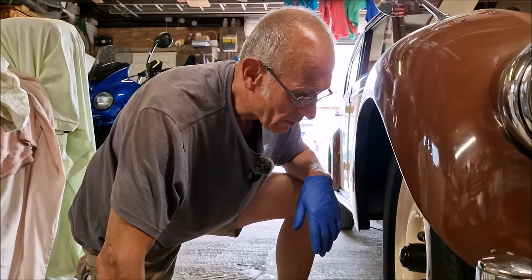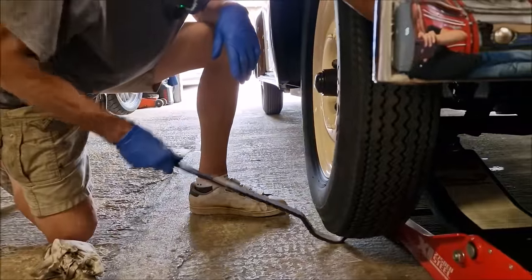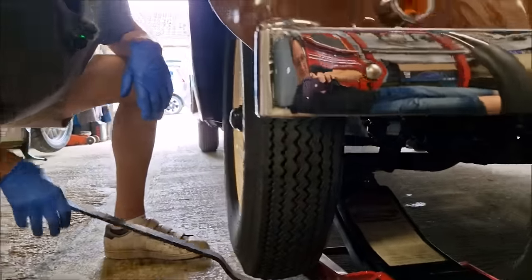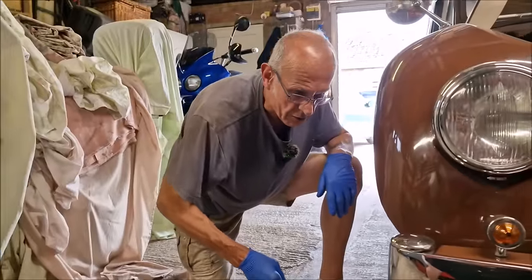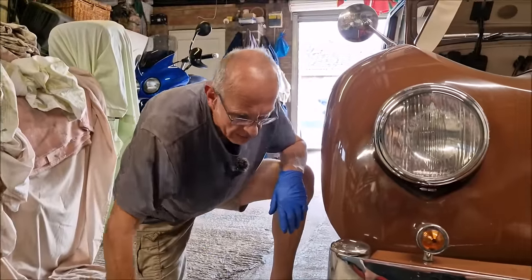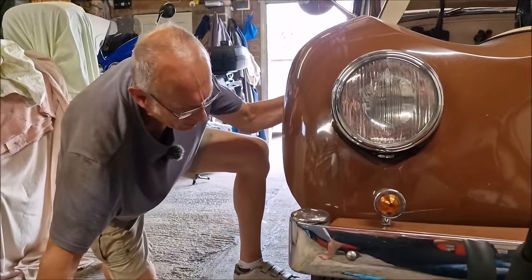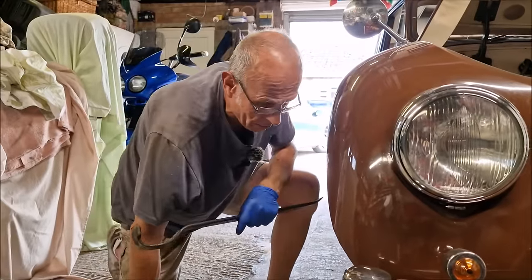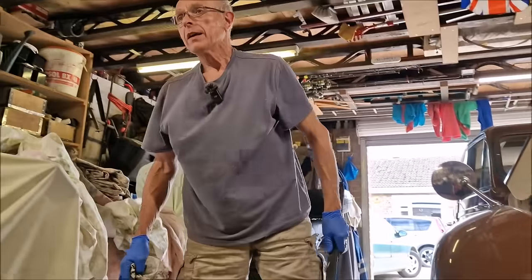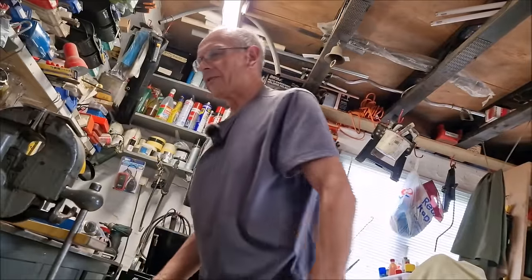So how have you diagnosed that? I've been laid underneath it doing what I've been doing here - you've got a crowbar underneath that wheel and we can see the problem. I've got the jack under the lower arm. It's got torsion bar suspension. That's to take the weight off so I can see the ball joints. Lord only knows what it would be like if you had the weight on. Might not be able to see it with the weight on. So we've got to do some welding?